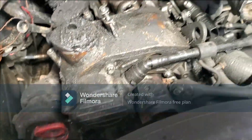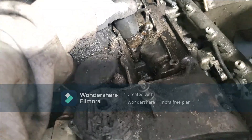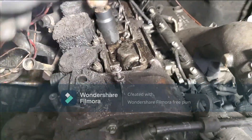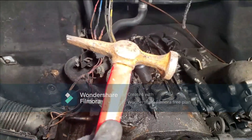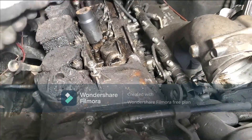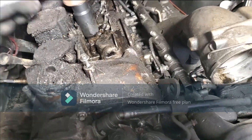So for anybody that this works for — great. What you do is put the... I actually came up with this idea. As you tap there, you're vibrating that whole assembly. You don't want to be using a mallet — this is an auto body hammer. It doesn't need to be a mallet, you don't want a mallet. You want it to be metal because metal on metal makes it vibrate more. A dead blow mallet won't give you that same vibration. You just keep tapping at it for a while.